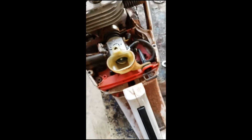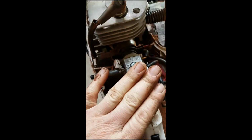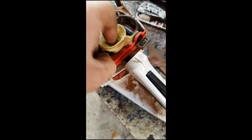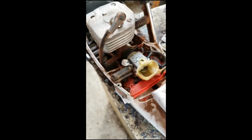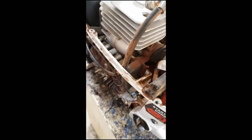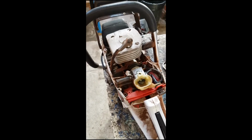Yeah, and I could plug that up and actually go ahead and put this in the parts washer. I could leave all this in one piece and take that to the parts washer and clean it as is. If I get any degreaser in there, that's not a problem, because all I do is put some 2-stroke fuel in there, flood the engine virtually and pull it over several times with the spark plug out, to flush out any moisture. Then obviously start it once it's all back together and just let it idle, to warm all that through.